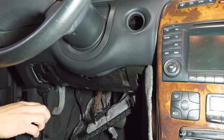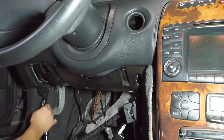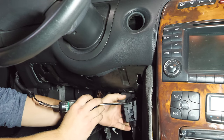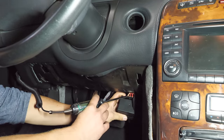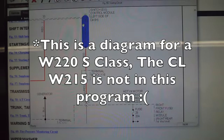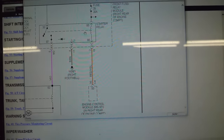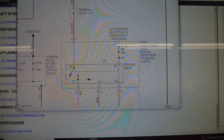I'm back-probing the EIS. I do not have power at terminal one, but I have it at terminals two and three. Let's go look at the wiring diagram. Terminal one is terminal assignment one but they call it terminal 15 - that's tied to a start relay and there's a fuse. We need to go to the right front fuse relay module in the right rear of the engine compartment to check fuse 29, which is 20 ampere. I don't see any 20-amp fuses in here, which is alarming.